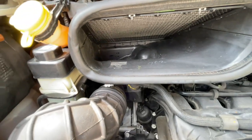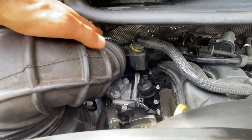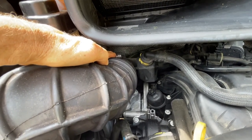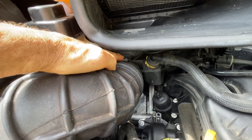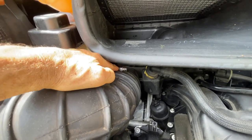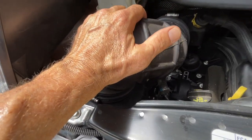Now on to what I didn't know. It's an air filter that's held in by one hose clamp right here. A flathead screwdriver will do it. You could also use a socket and a fitting for this, which would probably be just as simple, although there's not a lot of room — it's probably easier just with a screwdriver. It doesn't take a lot of time. And right over here is the second hose clamp, and those will pop off — this should come out.